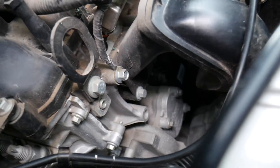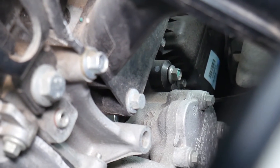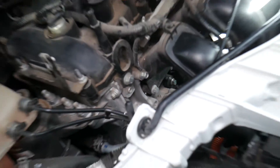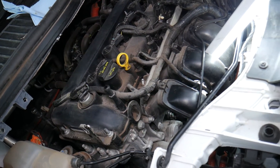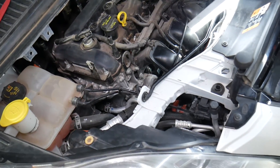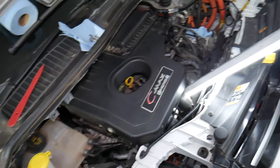Number three is a common mistake people make when replacing the knock sensor. It's super important to clean the engine block underneath it to make sure you don't have any sand, dust, or contamination. If you do, the new sensor won't be able to contact the engine block correctly, and from vibrations and improper contact, that can offset the knock sensor and trigger the code again. Hopefully this video is helpful — we have a replacement video on the channel and a parts link in the description below.